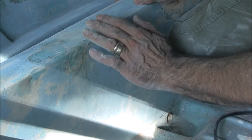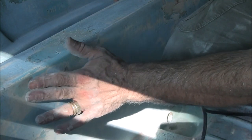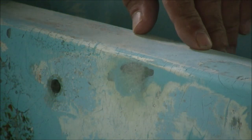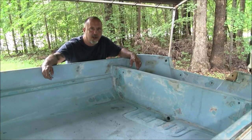Here are those two holes I patched — I already sanded one down and you can see it has a little bit of a dimple but looks pretty smooth. I'm going to sand the other one down to show you how it looks. There you go — a little bit more sanding, some fairing compound, and it'll be indistinguishable. This one almost doesn't need fairing compound but I'll add some to smooth the surface. Once we get the fairing compound on it, get it sanded and painted, it'll be pretty much unnoticeable. Hope you've enjoyed this video — if you did, hit like, subscribe, hit the bell button, and make sure to share it. Thanks for watching.